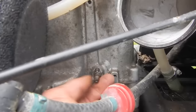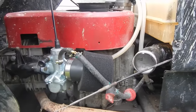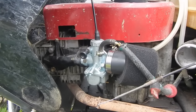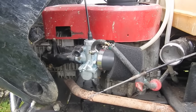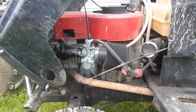I left all of the original centrifuge stuff inside the motor — it's still in there. I've run this thing for three years now without a governor and have not blown it up. The reason being is that I'm responsible with the throttle. I don't just sit in third gear and hold it wide open until the engine blows. If it's under a load, give it all she's got, but don't hold it there long — just like a car.